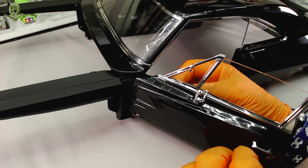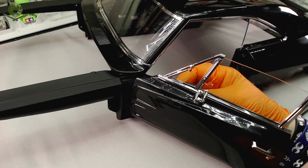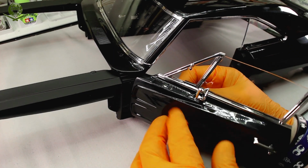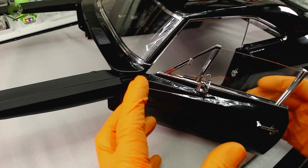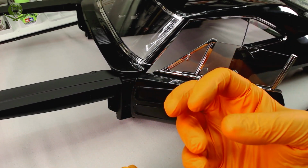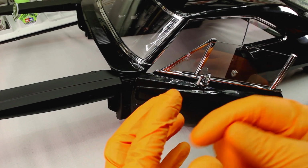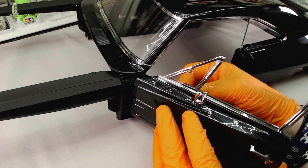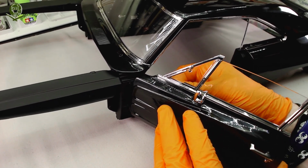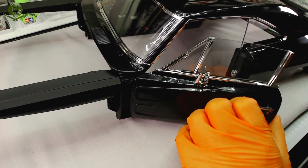So now what I did was take the door completely apart. It took like half a minute. I rebuilt all the cog assembly and made sure the handle was pushed all the way in. I actually had to file the handle bit that goes into the plastic cog, into a little D-shaped hole. It was a bit too small, so I just filed around the edges of it to widen it a little bit, pushed the handle in all the way, and now the window opens and closes all the way properly. Yeah, it goes that far down. So there you go, I'm glad I took that apart.